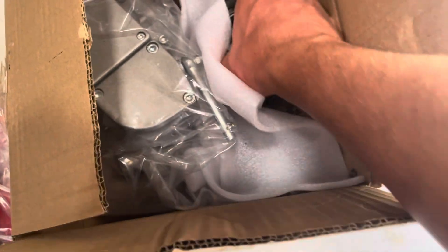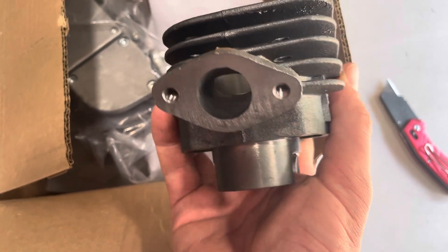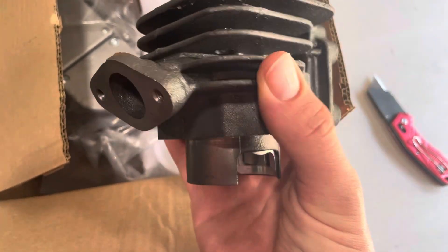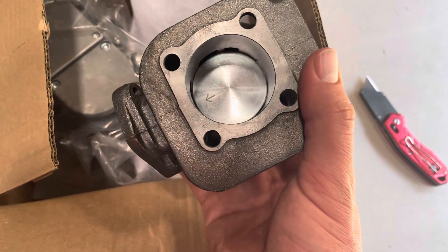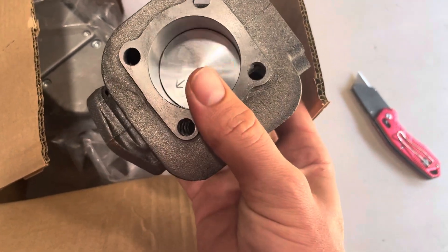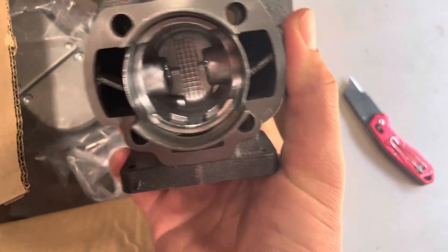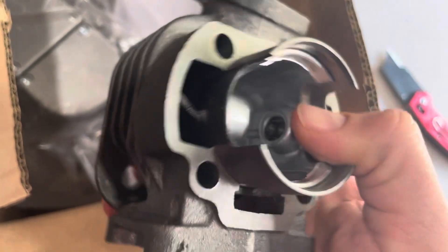Here is the cylinder — this is what makes the magic happen. The exhaust port is bigger than a normal exhaust port at a 48 millimeter spacing, and they sell an exhaust pipe for this on California Motorbikes that fits directly. The piston is the same size as a normal motorized bike piston at 47 millimeter, however this entire top end is essentially an Italian scooter engine by design. You've got these really big transfer ports — it's just a very different design from a normal motorized bike cylinder.